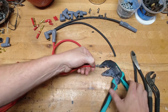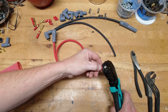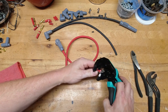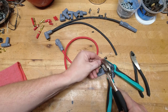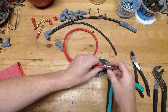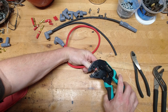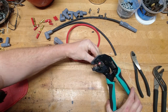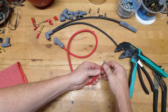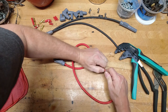Angle it just a little bit and make sure the wire is pushed down so it gets a good positive connection to the terminal end. It's the top first slot on the tool that crimps just that end of the wire. Then just ratchet it down — it locks the wire to the terminal end. Check it to make sure. Once you're satisfied, ratchet down the end that goes into the insulation. Pretty simple, pretty easy. I do like this style just a little bit better, but they both work very well. The tool is the key here — using the right tool. For the dual terminal end, you almost have to use this style tool. You can try side cutters, but you just can't seem to get the right lock on the wire. This crimping tool is the way to do it. That's how you assemble the dual crimp style end.